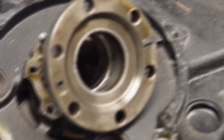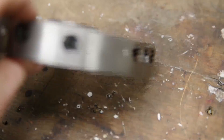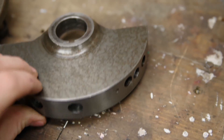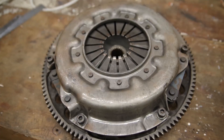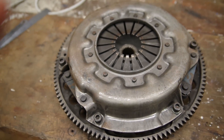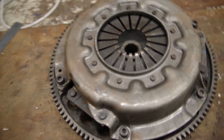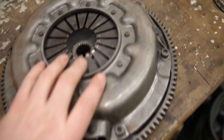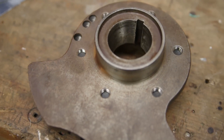These gears are nitrided, so that's the benefit. The front counterweight is pretty much identical to the 12A Series 1 RX-7 counterweight - exactly the same size - but if you were to use this rotating assembly you'd really want to get it balanced again. The flywheel on this engine is a custom-made billet steel flywheel - it only weighs about three and a half pounds, or about one and a half kilograms - very lightweight compared to the stock cast iron unit. It is of course mounted to the automatic 10A counterweight on the rear.